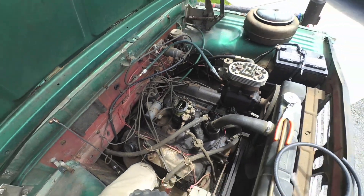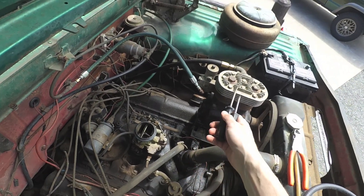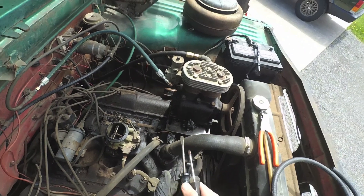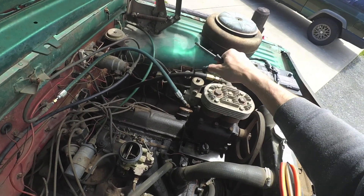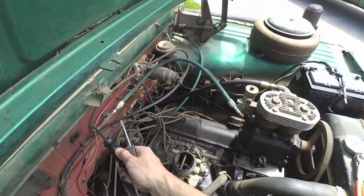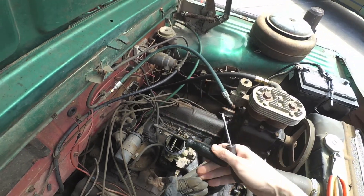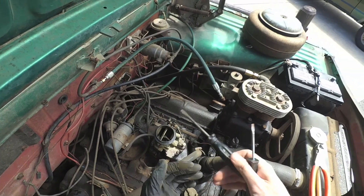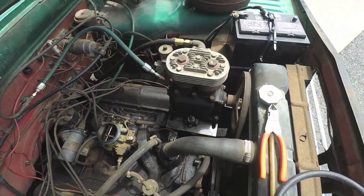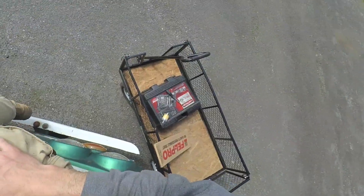It's a pretty clean old engine. There's an air compressor here that feeds power to the air-over-hydraulic brakes. If you've seen my earlier videos from last summer when I bought this thing, I had to refabricate these lines because they were made out of copper. As I drove down the road this line was vibrating back and forth and the copper actually sheared in half - I lost all power to my brakes, which was scary. New lines in now and it works great.